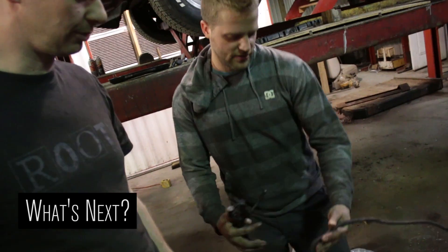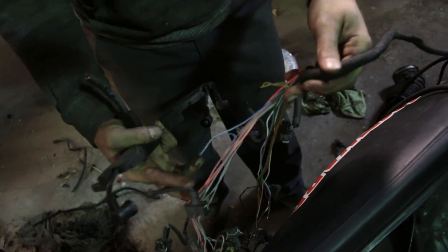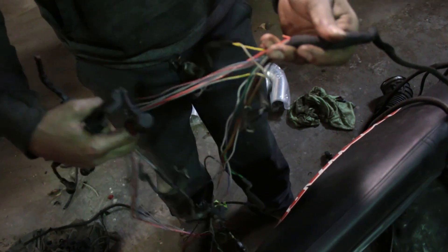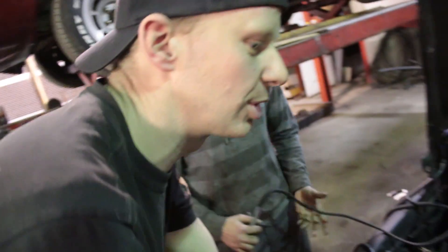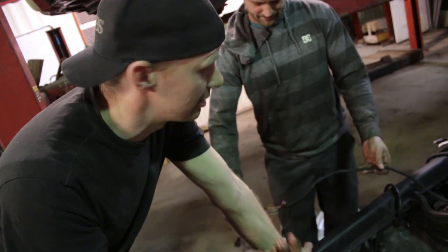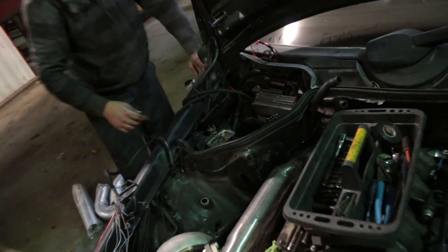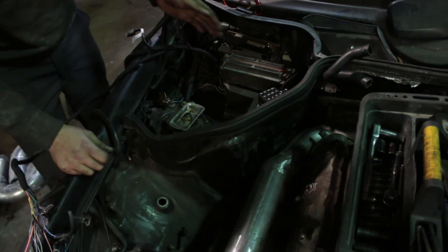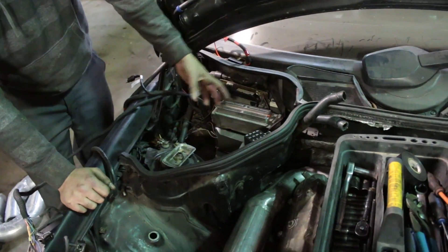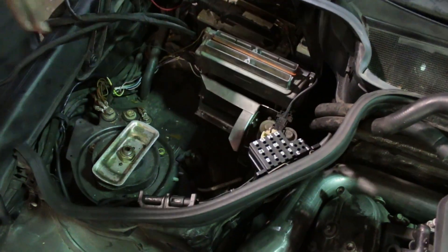This is just the Mercedes harness from the original Mercedes motor. I'm just going to cut off what we don't need and just clean it up so that it's nice and tidy. This engine is actually pretty cool — at '94, it's basically the same wiring as the LS's in 2006 or 2002, whatever that computer is. So here is where we're going to mount the computer for the LS. The original Mercedes computer's here, and we're going to take our GM computer and put it right here. We built a little bracket — we're going to clean this up nice.